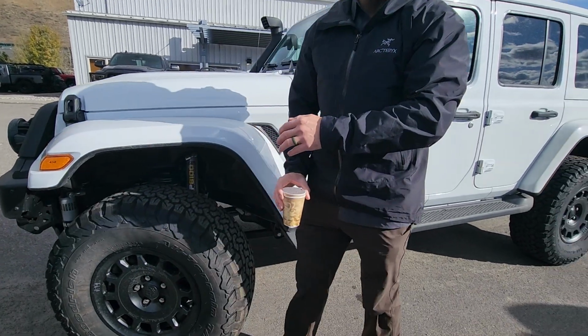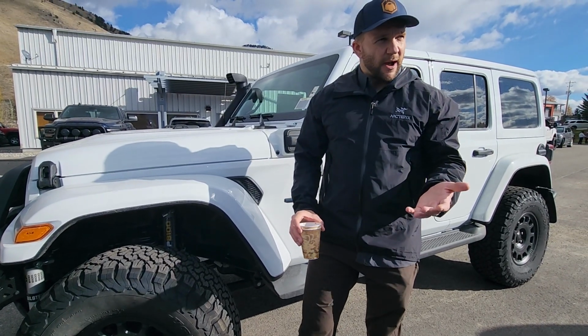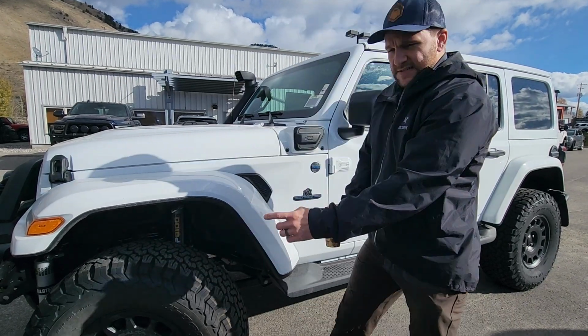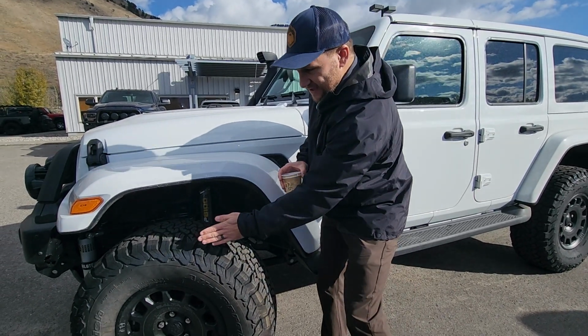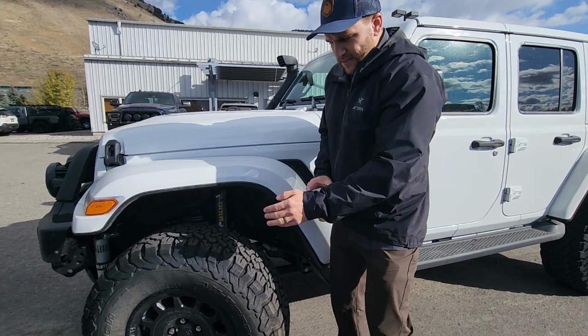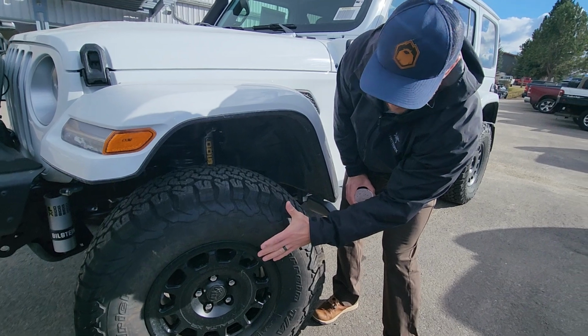All of our wheels have the same dimensions because we only make them for the Wranglers, so there's kind of a sweet spot on the Wrangler to put that wheel. You don't want to stick the tire so far outboard that you're slinging mud all over the place, you're compromising your turning radius, and you're putting strain on your ball joints. You don't want to position the tire so far inboard that it's rubbing on everything, so there's kind of a sweet spot. Then 17, we always use a 17-inch wheel because we want to give you the sidewall.